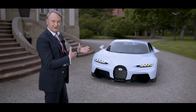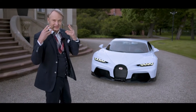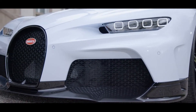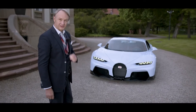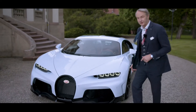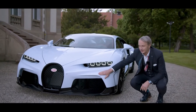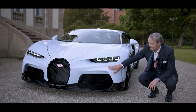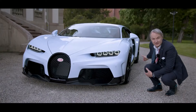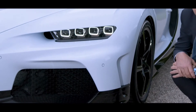When you look towards the front of the car, you notice the slightly angrier-looking Chiron, and you also notice those voluptuous cheeks left and right in the corners. They give quite a sexy automotive stance to the frontal appearance, but they also serve a special technical function. We call them air curtains and they control the airflow around the wheel arch. It's extremely important to get those right, because every mistake made here is pretty much an aerodynamic catastrophe along the side of the car.